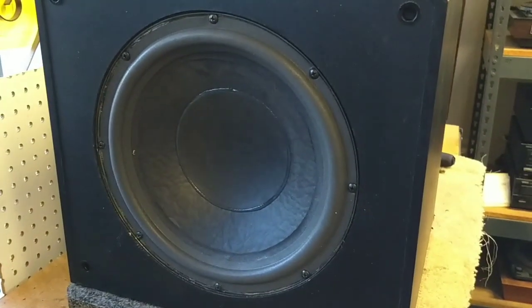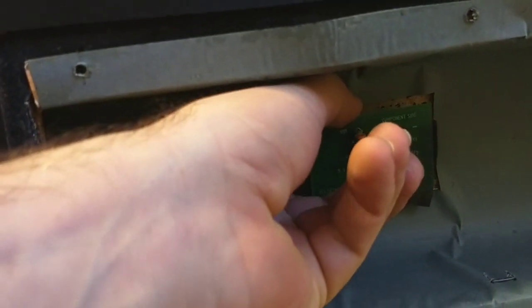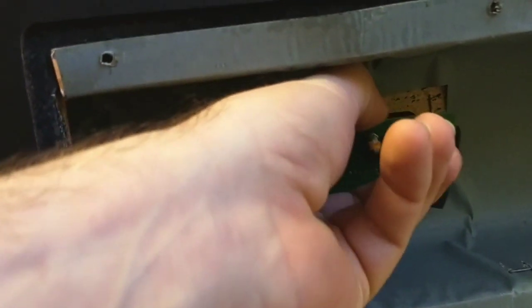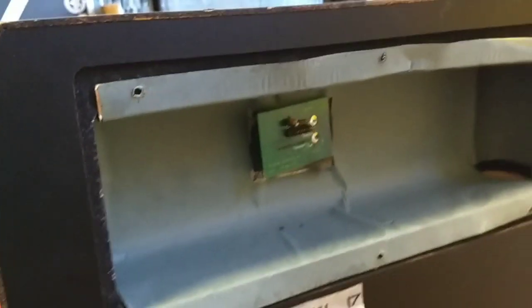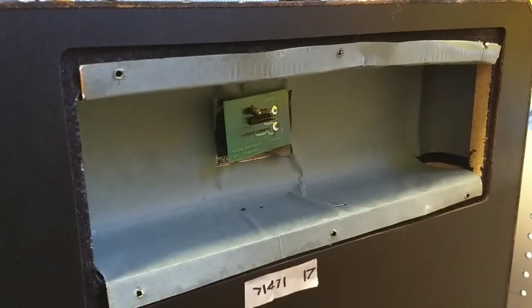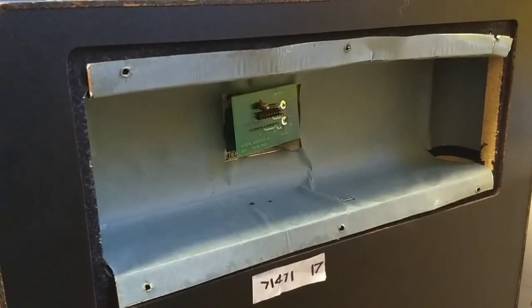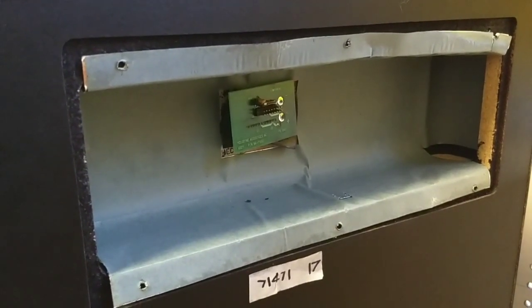This thing is really easy to take apart. From the back, you just remove the panel — there's six screws — and then it unplugs. It's on an extension, so you can just pull it out a little bit and then disconnect it from the board. I've got the board out and I'm ready to repopulate the capacitors. I'll show which ones commonly fail, and hopefully, if the accelerometer's not bad, that will fix it. So let's go to the board.